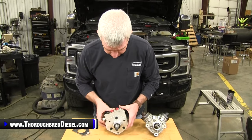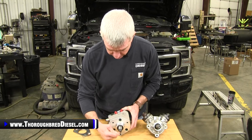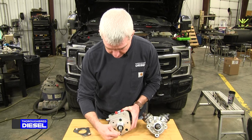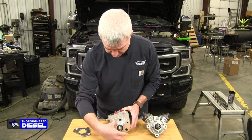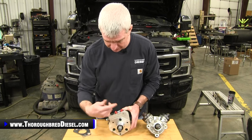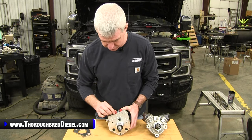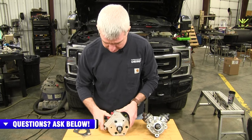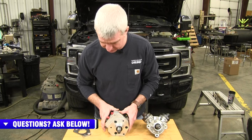And then when you turn it up to where it's going to be mounted, the drill point of this is actually going to be right at about the 7 o'clock position on a clock. So when it's set in the gear set right here, that drill point will be down at the 7 o'clock position. Once you get everything in and get your nut tightened on it, and you want to check to make sure that it hasn't slipped time, that 7 o'clock position is where it's going to be. But laying on the bench with everything like this, it'll sit down at the 6 o'clock position.